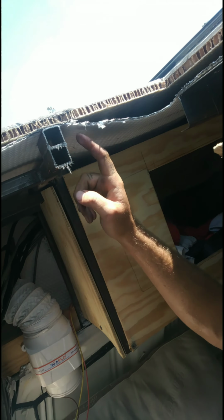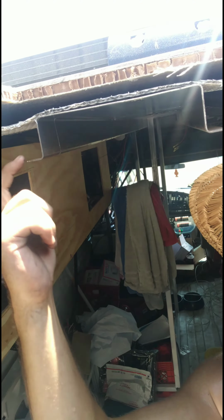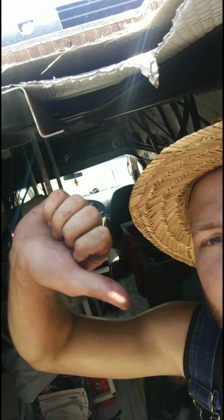So, main problem was double rails here, single rail here, goes into flat, which I didn't have to cut, but here there was some channeling. Trying to cut this angle up, over, down, over was a pain. You had to do it from the inside and start like this. My thumb is the blade, and cut and roll as you went. Get to this side and then cut straight like this, and then go straight towards the wall.